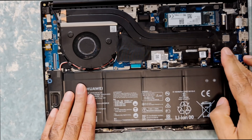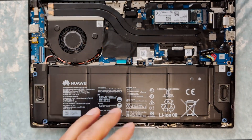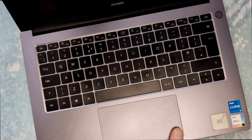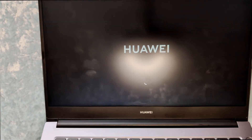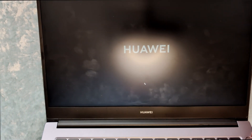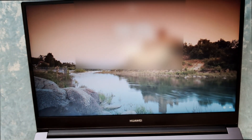So we have our video cable attached and our Wi-Fi cables attached, and now we should be able to test it. It's a good idea to put the back cover on without the screws, and then test it before doing all the screws. We have the battery - you can see some lights. Screen looks good. Keyboard looks good.